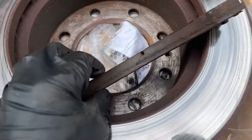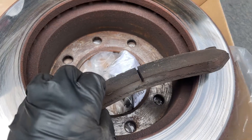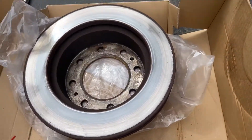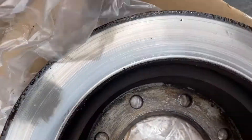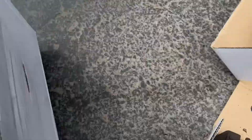Although you see the material on these brake pads looks great — there's probably 70–80% of the pad left here — what I wanted to point out is why I'm replacing these rotors and not resurfacing them. I'll go ahead and get this wet so you can see the color more evenly. This one has got a nice baked black line evenly all around the rotor. That's the passenger side.